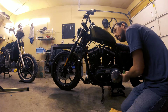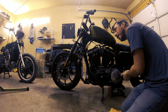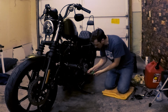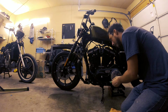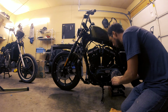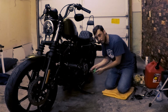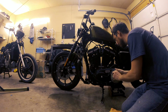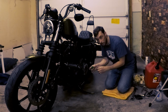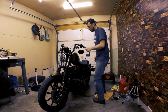I don't have an inch-pounds torque wrench, but if you do a little bit of math, 108 inch-pounds is 9 foot-pounds. I still don't have a torque wrench that goes below 10 foot-pounds. So I'm just gonna tighten these by feel, and as I ride, I'm gonna check them occasionally to make sure that they're still tight. Maybe by the next video, I'll have an inch-pounds torque wrench. It's looking pretty good.